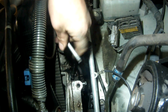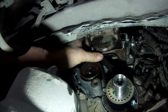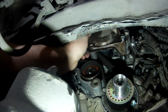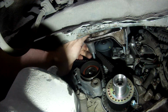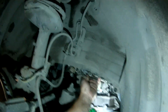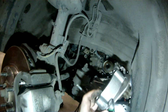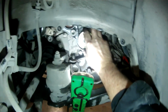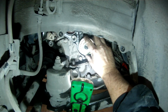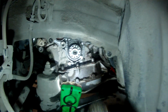In this case, the lower stud stripped out as I was attempting to remove it, but I was able to remove the motor mount plate with just removing the upper stud and the bolts. That allowed me clearance to extract the stud after the plate had been removed and replace it. Now remove the guide and note the position of the guide with the rounded surface towards the belt for reinstallation.